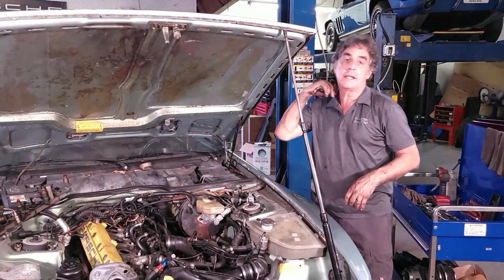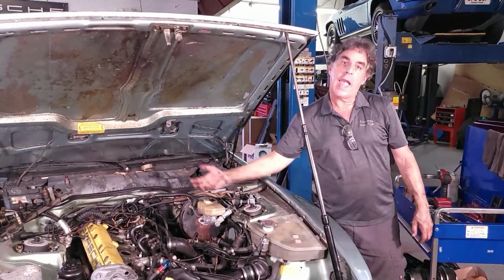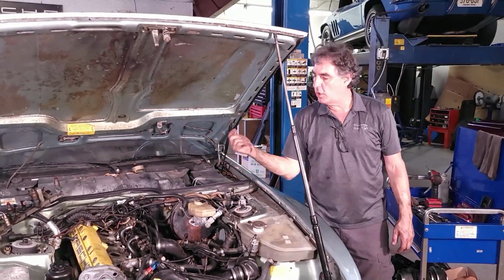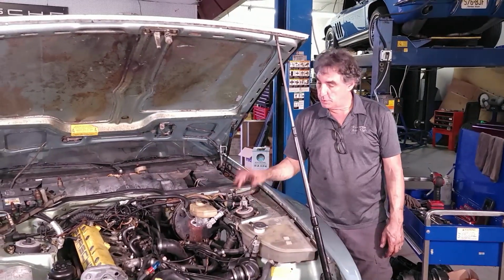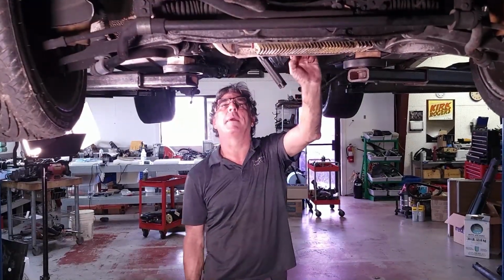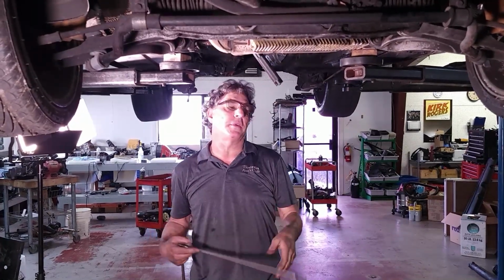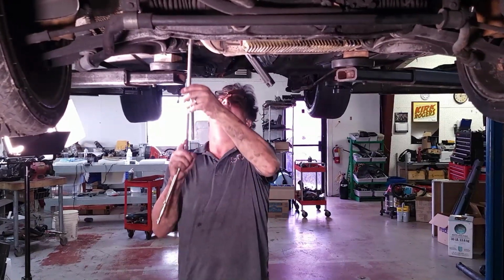Now we'll go back up and take the other half of the pipe off of the triangle flanges underneath. Those bolts might break, they go all the way through, so it's not a big deal. So we'll see you back underneath. Alright, it looks like I'll be able to get them off with an impact swivel. I'm going to break them all loose, and then I'm going to try to use a gun to get them out the rest of the way.